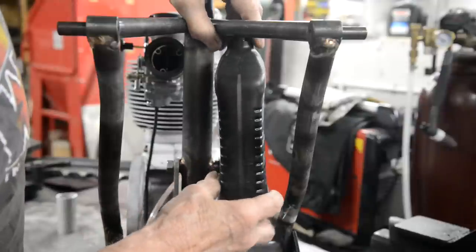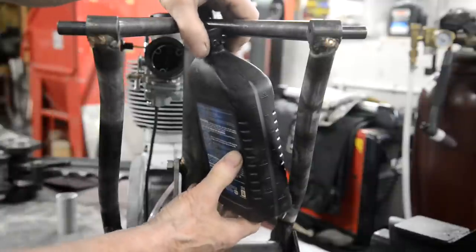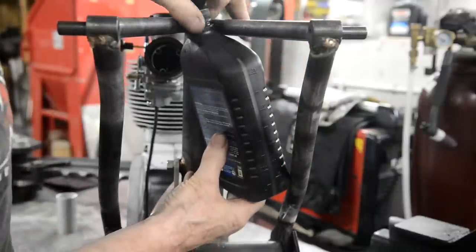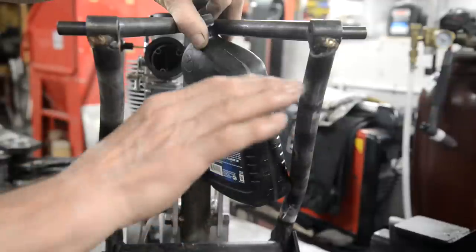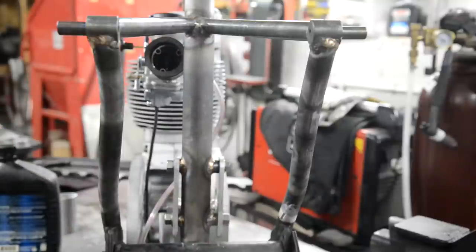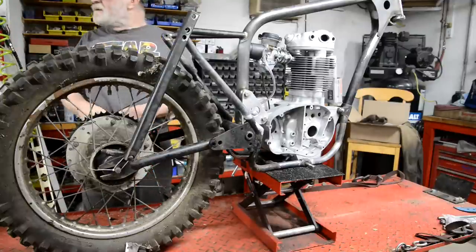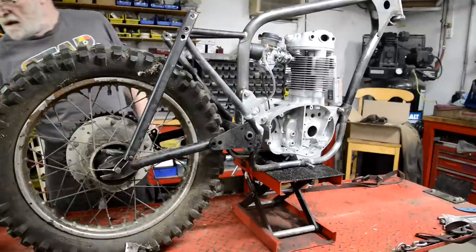So we could fit that in about like that. You remember the Triumph one, we did it, we sloped it on the outside here. And that still gives a certain amount, but we have to make sure we have enough room for our mudguard. So let me go and find an old mudguard and we'll fasten that in temporarily. Right, so here we've got an 18 inch wheel in. We've got our unit set at 14 inches, our rear suspension units. So that's how it would sit normally.